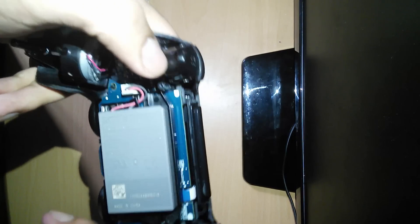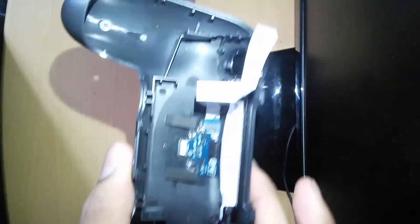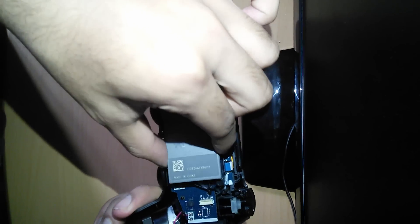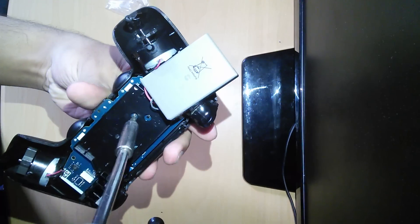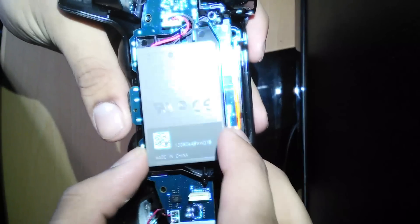What you need to do here — as you can see I'm missing the L2 button trigger, still some stuff on there but I'll take that out later. What you now need to do is remove the battery, and there's a screw still in there that I just need to unscrew. What you may need to watch out for is the reset button here, because that might come flying out — it normally does. But it didn't this time so I'm lucky. Just put that down.